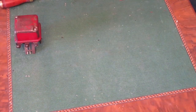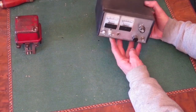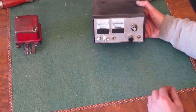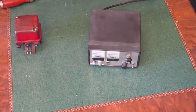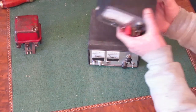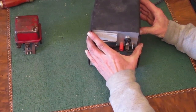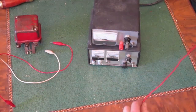That covers the different styles. Next I'll show what I use to test and set up these regulators. This is a homemade power supply I made years ago — it's made to power 12 volts and less, with a knob to adjust the output. But these regulators need to get into the 13 or 14 volt range when charging a battery, so I need more power. Here's another one I made. I'm going to connect these two in series so I'll have an adjustable power source in the correct voltage range.